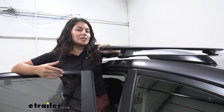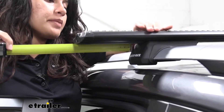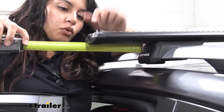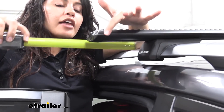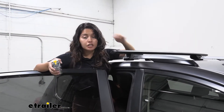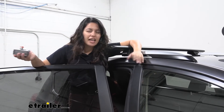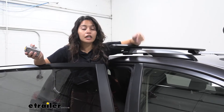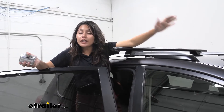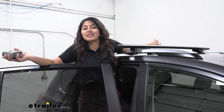Let's take a look at different specs and measurements. Since these are the extra long legs, we'll first look at the overhangs — that's the biggest perk. Measuring from the end of the tower to just before the end cap, it sits at about four and three-quarter inches of overhang. That overhang is especially important with kayak carrier accessories, particularly load-assist ones like the Yakima Showdown or the Thule Hullavator, which require that overhang to load kayaks. It's also helpful if you want more crossbar space to carry more or larger cargo.